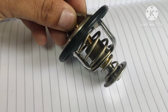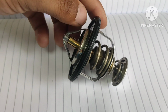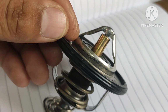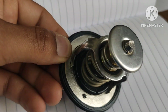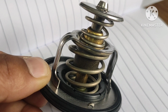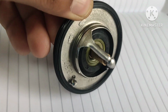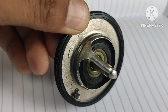And this valve is one of the major components of the engine cooling system and is located on the top of the engine head or on the upper cooling lines. And this valve either cycles the hot coolant towards the radiator for cooling, or it bypasses the cool coolant towards the water pump for quick warm up of the engine by observing the temperature of the coolants. So these thermostatic elements transfer heat energy into mechanical energy using the thermal expansion of waxes when they melt.